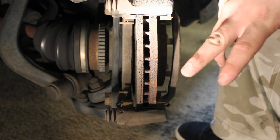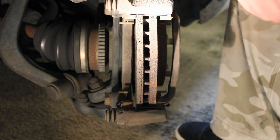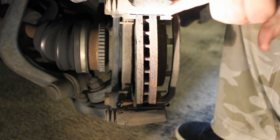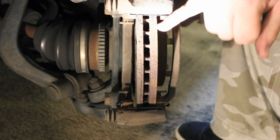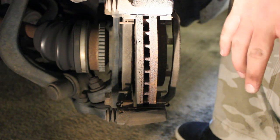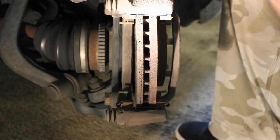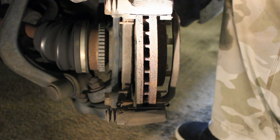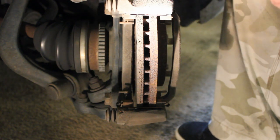These are at 27mm, so they're fine — I can put the pads back on and drive it. But if it's below 26 millimeters, you will need to purchase new rotors. You can't resurface them because that just takes more material off, making it unsafe to drive. So now I'm going to show you how to replace your rotor if you need to, including how to get the bracket off.